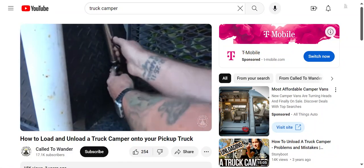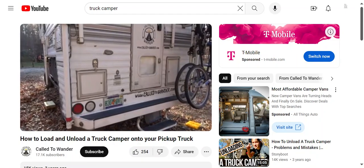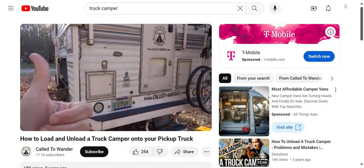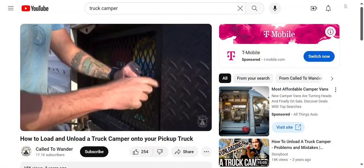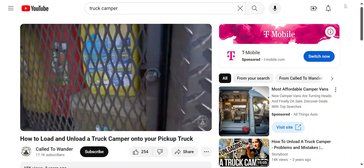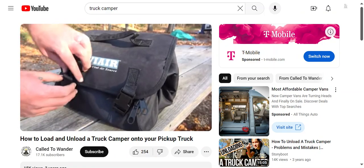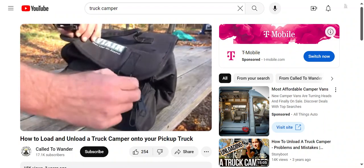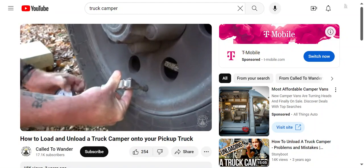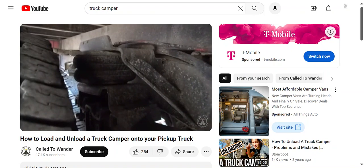Now do your final check. Make sure all tie-downs are secure. Test your electrical harness to confirm brake lights, turn signals, and reverse lights all work. Stow any additional items in their appropriate places — in our case, we keep extra fluids, fuel, and leveling blocks in an outside storage area. Finally, inflate your vehicle tires accordingly; we keep ours at a maximum of 80 psi. If you have airbag suspension as we do, inflate that accordingly as well.